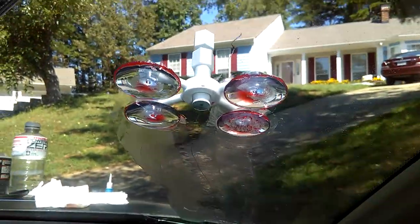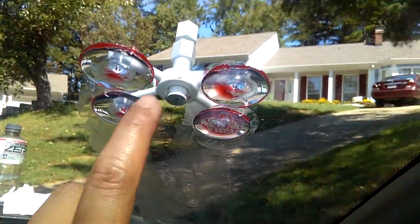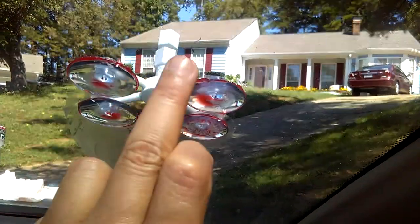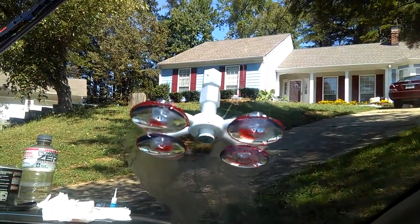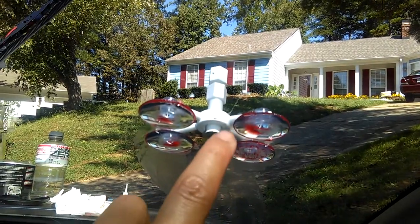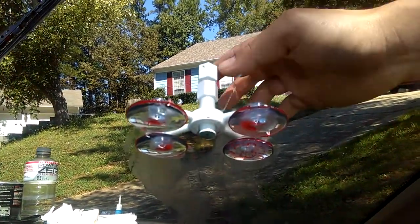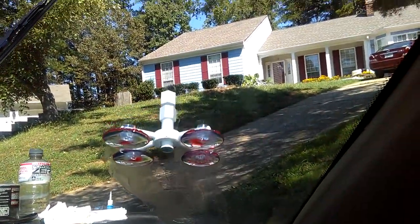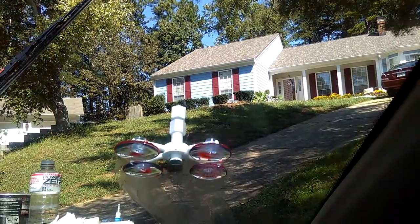You need to use another hand — use your finger — and push either side of the crack. Don't push right at the crack; push on either this side or that side of the crack on the window. That gives some pressure to open the cracks up so when the resin falls in it falls right into the cracks and you fill it up.